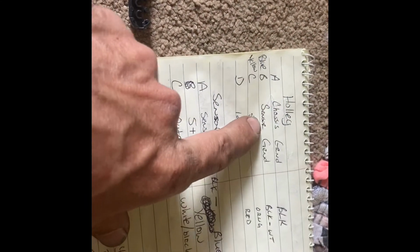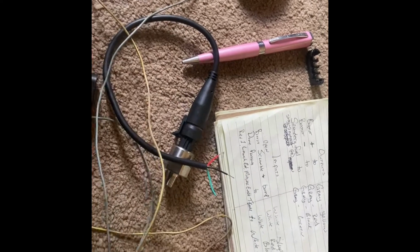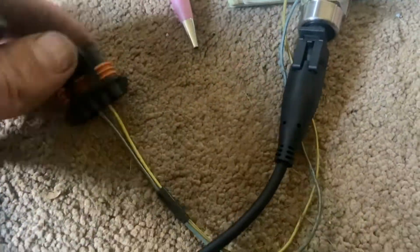Okay, and you can see we got our pin map all done now. On our Holley output, we know that the blue and the yellow is on the side that we wired, and that goes to the sensor. The blue is the ground, yellow is the 5-volt reference, and our output, which is the green wire from this sensor and plug, goes down to a dome pressure, Holley white with the black, so that wire's already there. So we'll just finish making these two wires, just simply wrapping some tape around it just to make a nice little harness, keep it all together. And we'll get those attached here and be ready to go out to the truck and figure out where everything's going to lay. So now that we got this all, we literally have to do is just refer to this and connect wires. Okay, we have this portion of the harness all done.